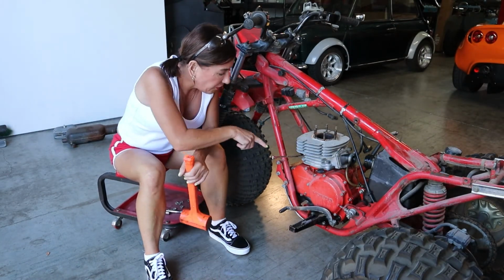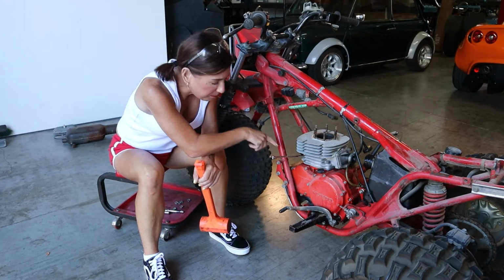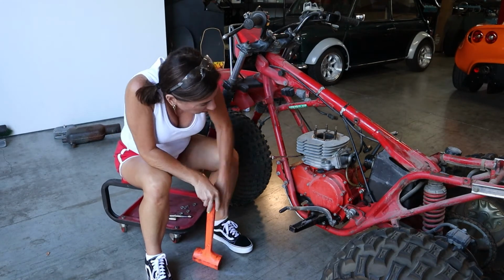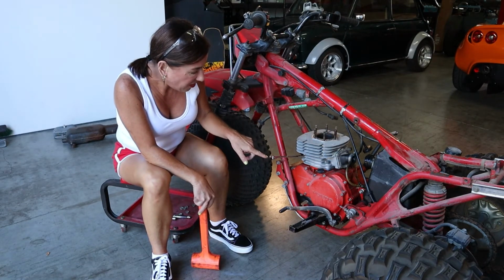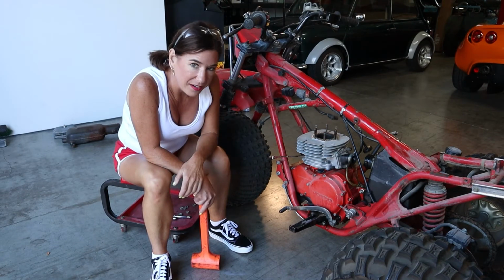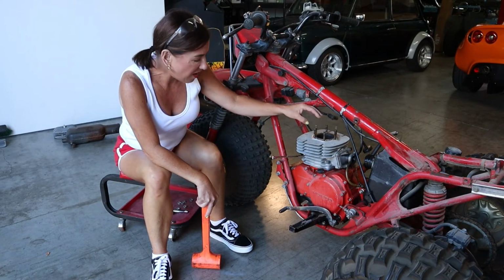So what we're gonna do, you see I already have my box end wrench on the bolt there. And it's super important you only use the box end. It even says it in the manual because the walls here are super thin. And with the pointy edge of the wrench here, you could actually poke a hole in it, which, yeah, no, let's not do that.